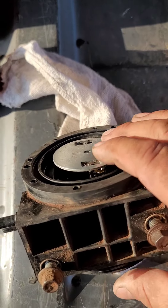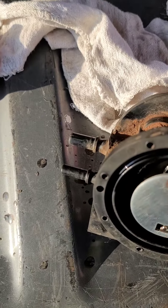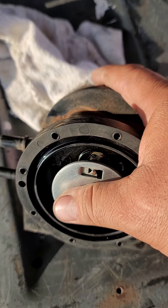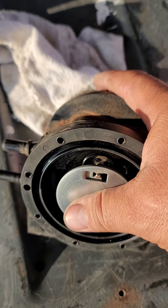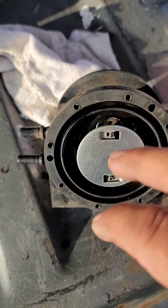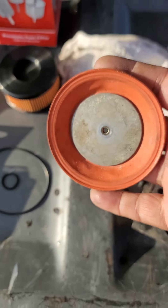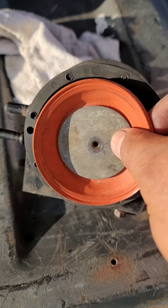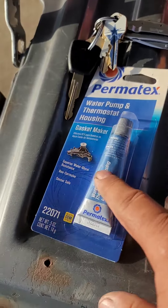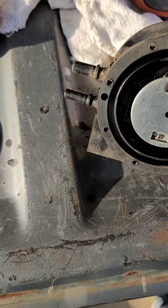I went ahead and cleaned my parts up already. I'm gonna make sure that this valve is free — it needs to go up and down, wobble, and in and out. That's what it should be doing. If it's not doing that, you need to work with it and break it loose. There's a diaphragm that goes here; it didn't come with the kit, but the old one seems like it's still in pretty good shape, so I'll be screwing that back down. I also got some gasket sealer that I'll put on the outside just to make sure — I don't want this thing leaking.